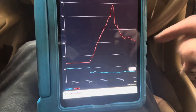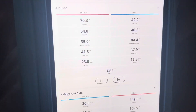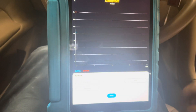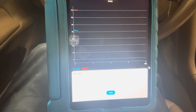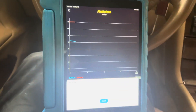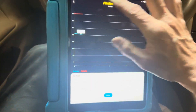Let's look at temperatures. We're coming out 42 degrees out of the dash right there, and you can graph that for your customer — start that graph, take the recording, add it to your sales slip, receipt, or invoice. Prove and document on every vehicle how it came in and how it goes out. You have live data streaming while the vehicle is in operation. We're at 41 degrees right now. Let's watch what happens with this variable displacement compressor.